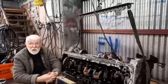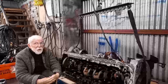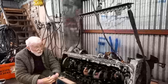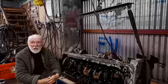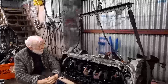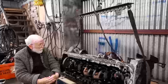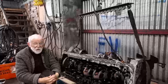So this is the orientation of the engine. When it's in the bus, this is the way it lies. We haven't actually done one of these horizontal engines like this in the past. So we're having SuperFung dismantling it. They were occasionally used in boats — I remember quite distinctly some years ago encountering a 5HLW in a barge down in Dublin. The reason was there was a very low ceiling in the engine room. Very often there's a problem with the height of vertical Gardner engines because of the long stroke.